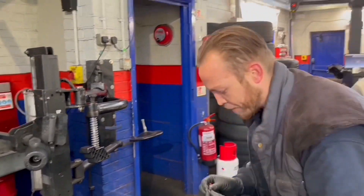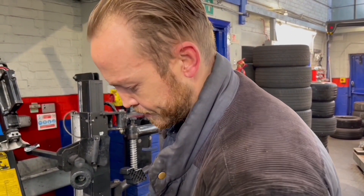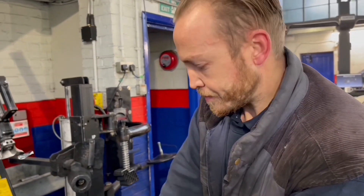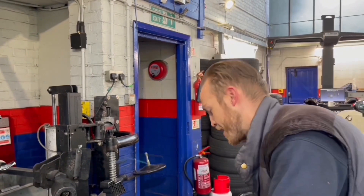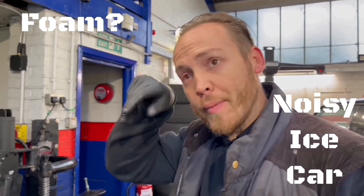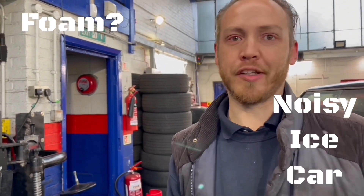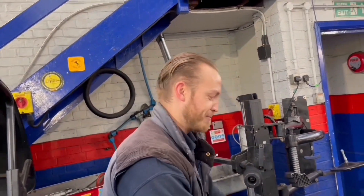What tyre are you fitting today? It's a Michelin Primacy 4 — a special fitment for Tesla. Most tyres have their own fitments for certain brands of cars like Mercedes or Audis. The advantage is that the rim size is fractionally different, so it holds the seal and tyre pressure better. As for the foam — it's inside purely because when the tyre rolls it creates noise, and the foam dampens it down. It doesn't do any spectacular miracle — that's all it is.